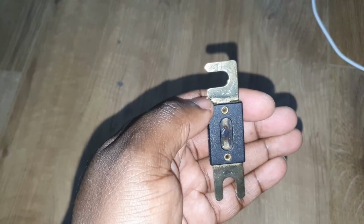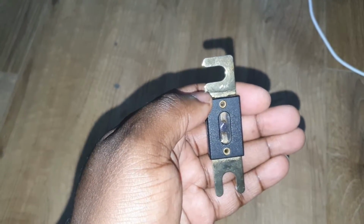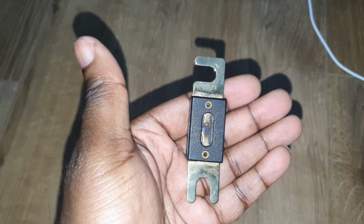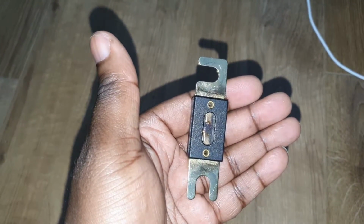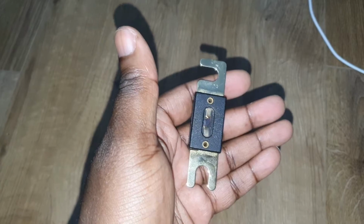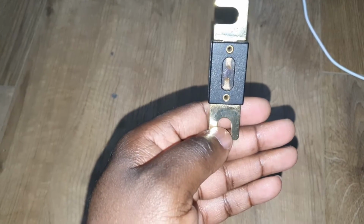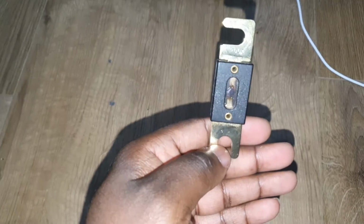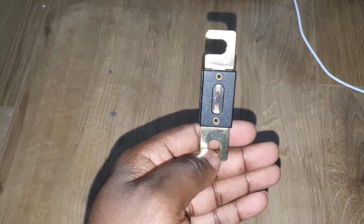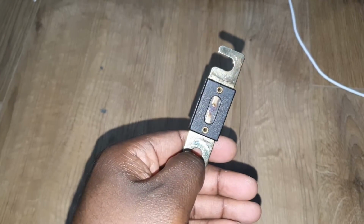So now at this point, this is why this fuse is out. I'm running on 2 fused power lines. They fuse on about 250 amps each on each line, with the battery in as well. So in theory, if there was a problem, 250 amps would, in a sense, pass through it before it blew. So that's the idea. But yeah, this didn't stand a chance. There was no electrical problem, so it did its job. But yeah, it was on its limit. Just thought I'd show you that. But as you can see, it's got pretty hot. And again, it was also in the engine bay, which didn't help.